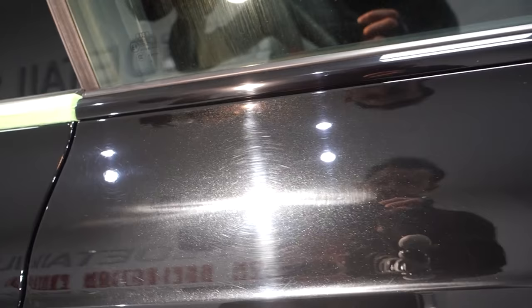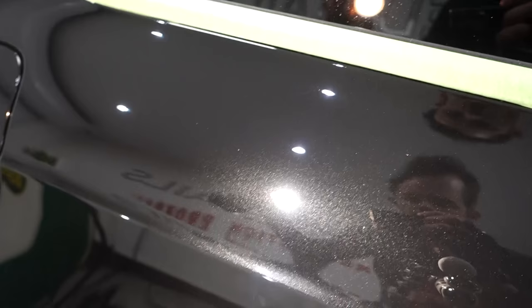So the buffer trail here, the wavy holograms, the lines overlapped onto the wing before. You can compromise the edges by doing this if you're not masking off or removing the edge prior to polishing. So you saw me lift the door, that removes the door edge out of the equation. Going forward, any other 50-50s you will see will be purely after the cutting stage, which will be hazy still. So this is a refined finish, this is a before finish, and what you're about to see will be cut finished, but not refined finished. I'm sure that makes sense.